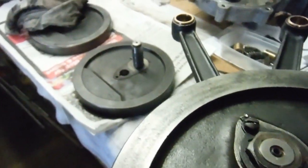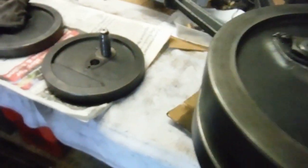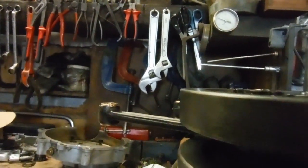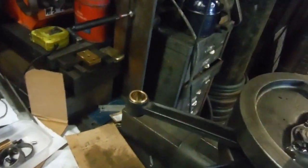If I put this spray can pipe into the feed hole on this side and give it a blast, let's see if we can see anything coming out the other side. Hopefully the camera will pick that up — I'm seeing it. That is the WD-40 passing right through from one end of the crank assembly to the other. So that tells me that both oil feed holes on the drive side and the timing side are capable of picking up oil and sending it through to the big ends.